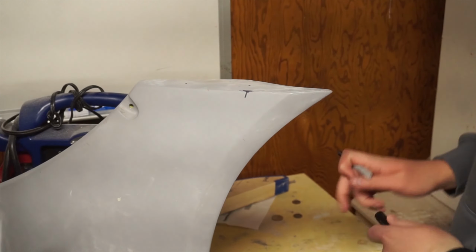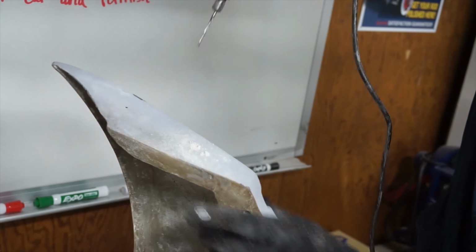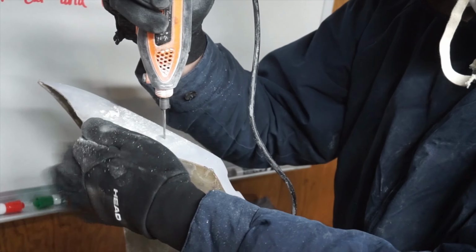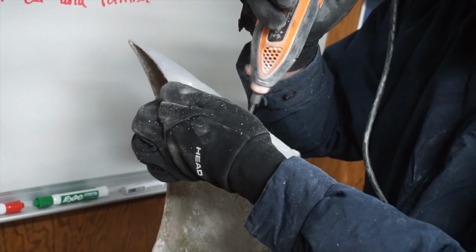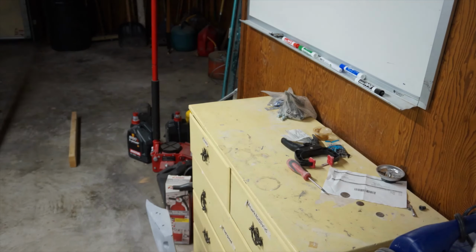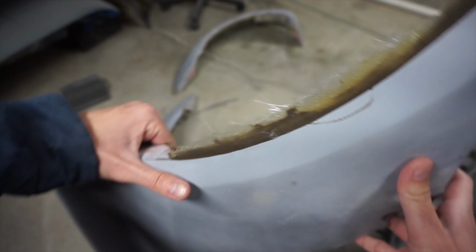I found out pretty quickly though that adhering fiberglass on the abrupt drop-off of the edges caused it to pull up and required filler work on the gaps. And the solution to this later was to put fiberglass filler on the edge before applying the fiberglass mat and resin, so the gap was filled while structurally supported from the back. It looked like this. Sounds complicated, but it's really not.